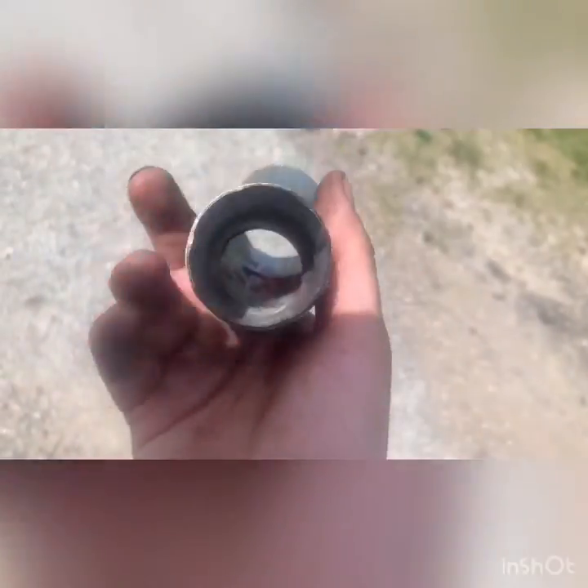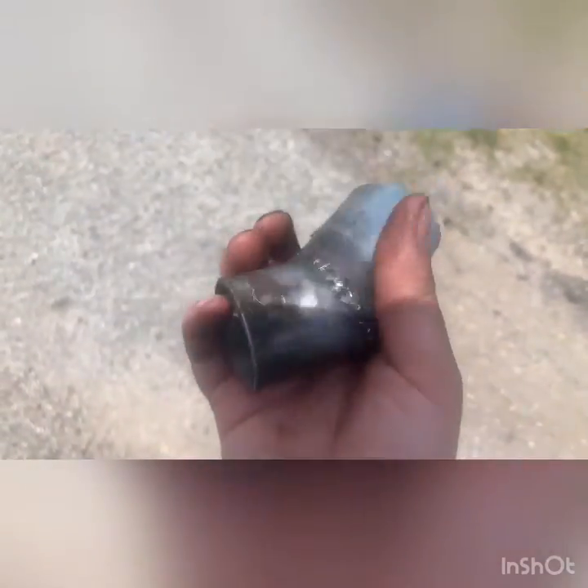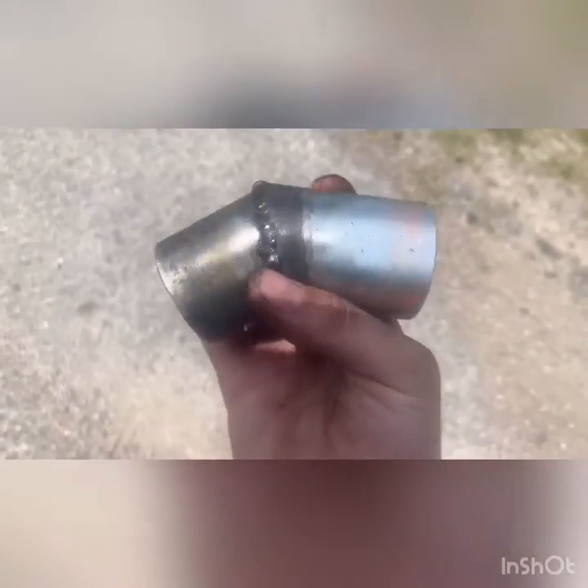The GT tank uses the factory lower radiator hose to the tank, and once it hit that T, I cut it — that's where I did the custom elbow joint. Absolutely nobody seems to sell a one-and-three-quarter to one-and-a-half inch elbow. None of the hardware stores had it, so I had to make it. I went to my favorite exhaust shop and had them weld two cheap exhaust pieces together into a 45-degree elbow.